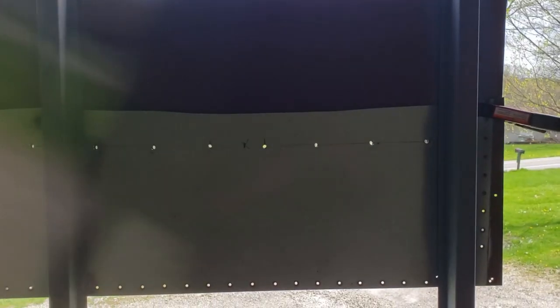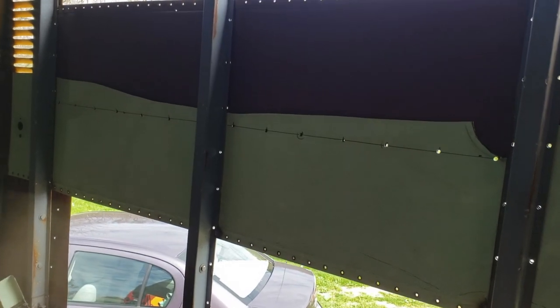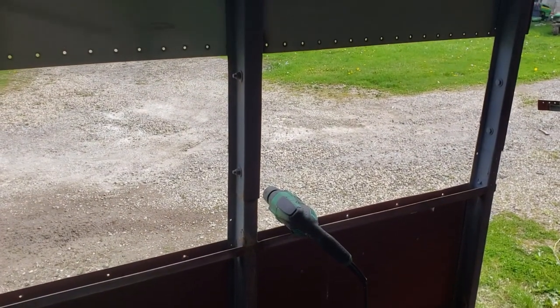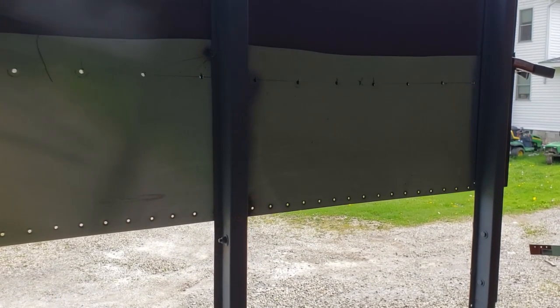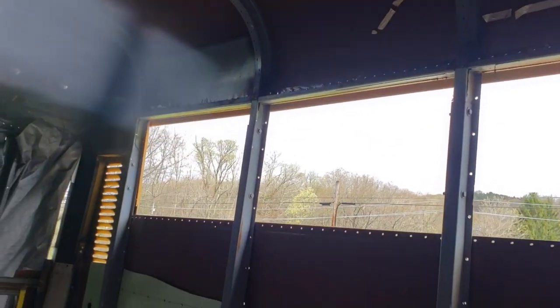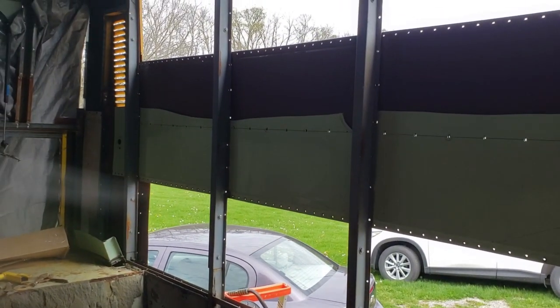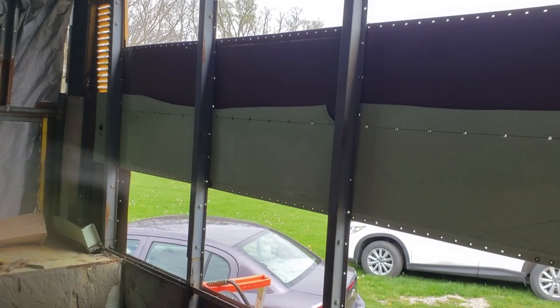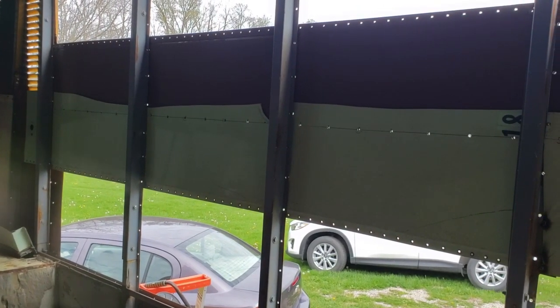So back at it here. Okay, so I drilled the center holes here horizontally for the first sheet on this side, and I'm almost done. Got this hat channel to do, and then I'll have the holes drilled. I'll be able to go outside and grind, and then I can place the first sheet on this side. Okay, so finished drilling holes for this panel. I got the top rail as I went, and also the middle. So I must be getting better at drilling, because this took nowhere near as much time as prior panels did. I guess my arm's getting stronger or something. So anyway, time to run the angle grinder on the outside, hit it with some primer, and then we'll get a sheet and hang it, at least on a couple bolts.